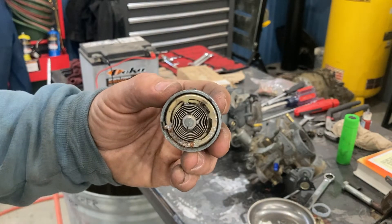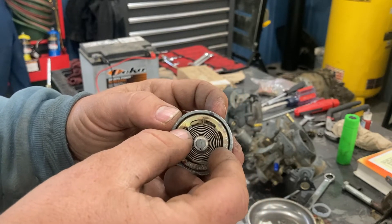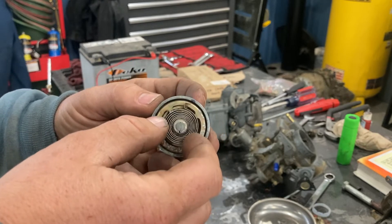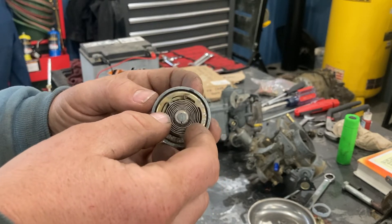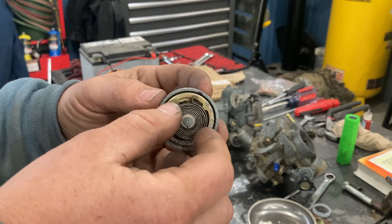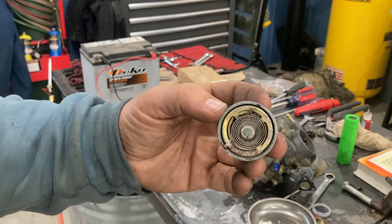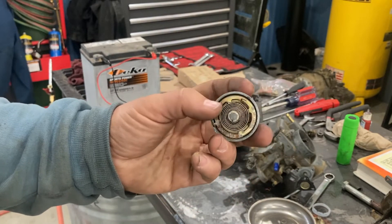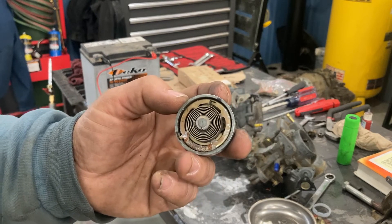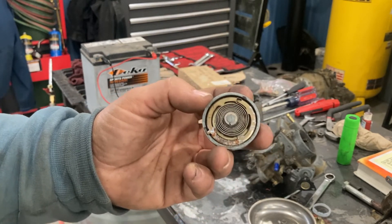Pretty cool. It's set to warm up at about the same rate that your engine will warm up. If you have all your tin work in place, the thermostat in place, the flappers in place, they engineered this so that it will warm up at the proper rate. If you don't have your thermostat and everything hooked up, this is not going to work properly at the correct rate. It's just another reason not to take out your thermostat and your flappers.